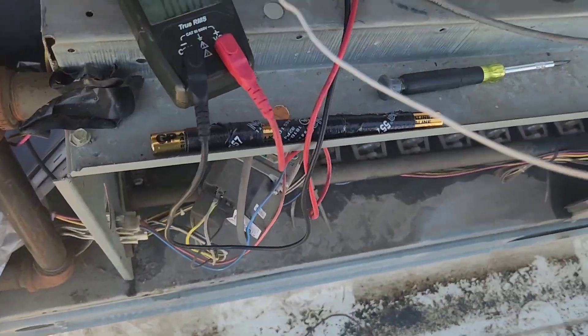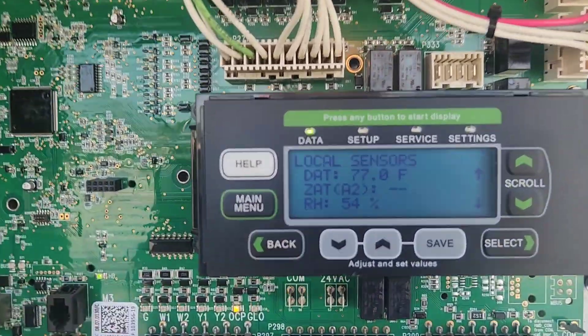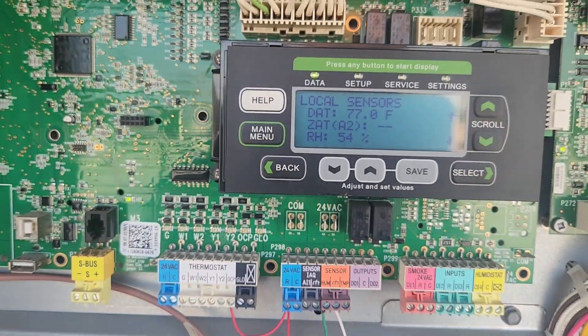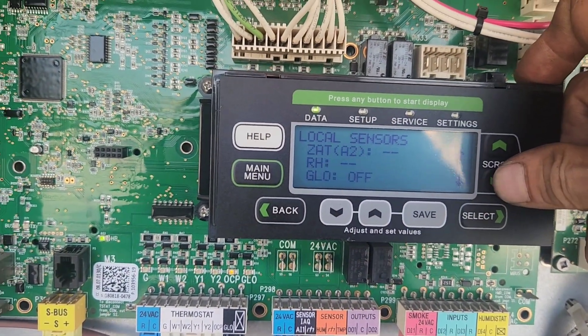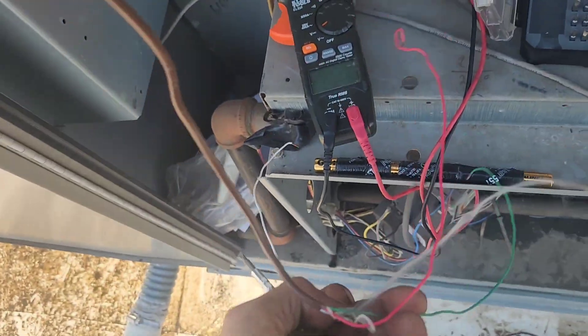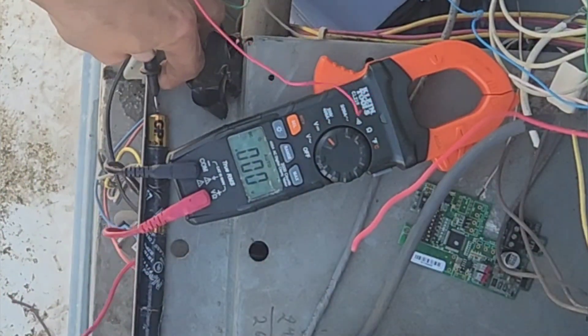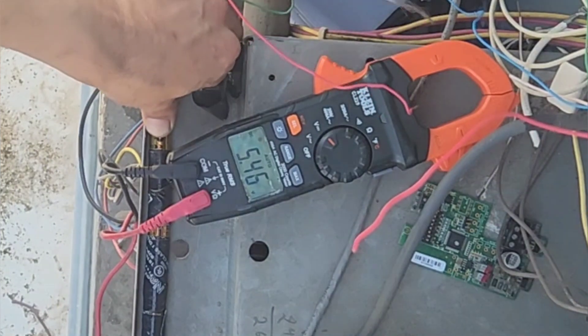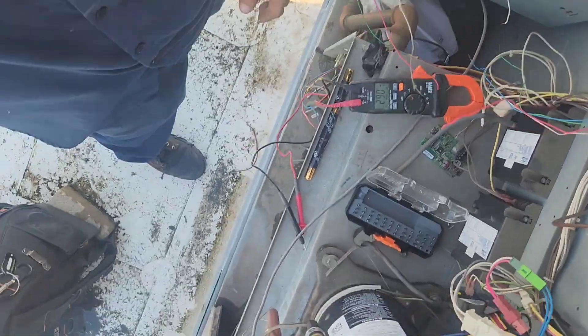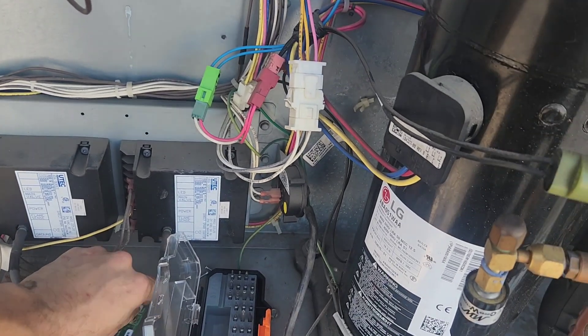I have to hold these wires — left hand on the white wire, right hand on the green wire — and use it to poke at the terminal here. I was able to get it to say 54%. When I put 5.46 volts to the board it says 54% humidity. That's perfect — that's right, that's in line: 5.46 volts equals 54% humidity. So everything here works — the board and wiring are good — but the sensor itself has failed and needs to be replaced.